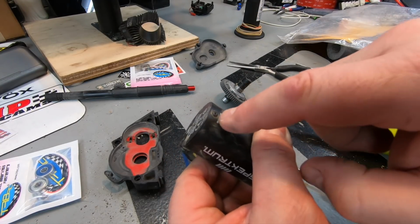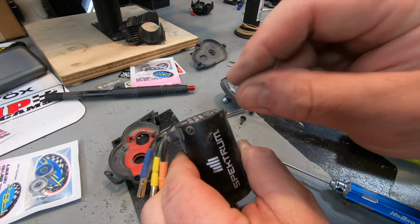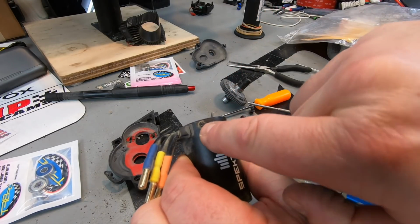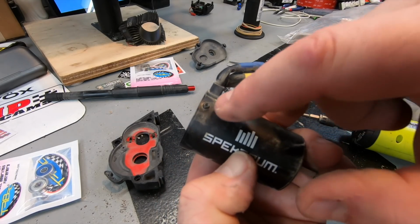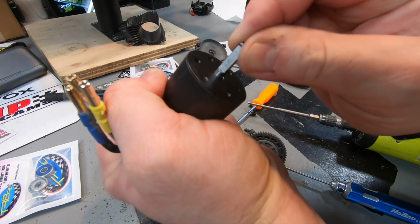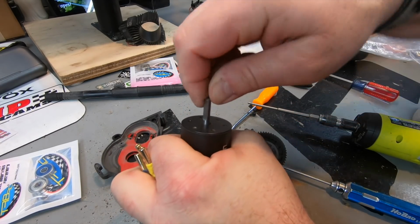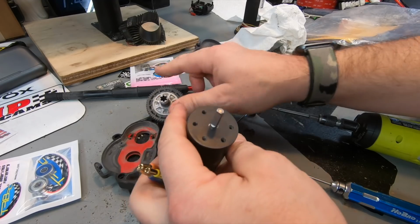That's a 1.5. These have a tendency to strip because, I've found on some of these motors, there is just the smallest amount of Loctite. And these little 1.5 Allen holes strip out very easily. Now you can see how bad that is. Hear that noise? Sounds like an X-Max bearing.